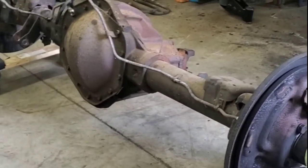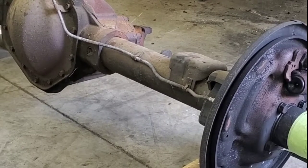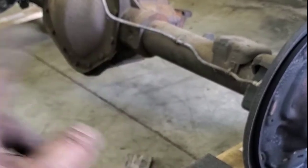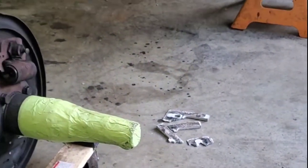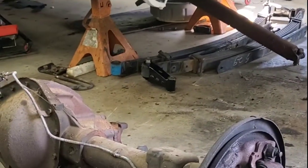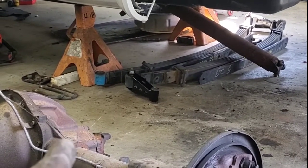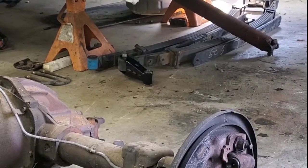And another reason it all came apart was because I want to replace the drum brakes with new ones anyway. So there was a lot that kind of went into just making the decision to pull the rear out — a lot of work to get it out, but it will make it easier for doing the cutting and the cleaning up of the new brackets. The pinion shim needed to be replaced, so there were a few things stacked up against me. Also, I figured why it was out, I'll do the 100,000 mile spring rotation — flip-flop them back and forth. It's good to rotate your tires; I figured why not just rotate the springs.